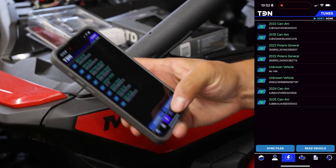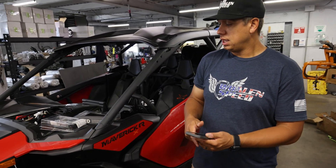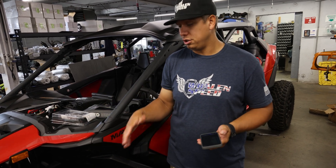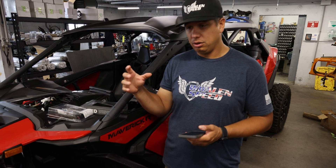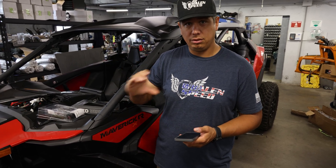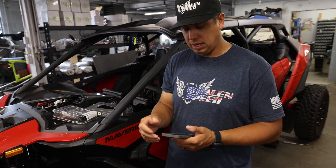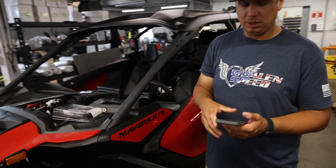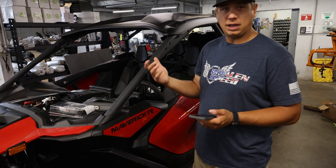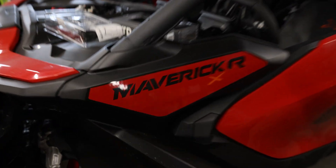At this point you're all set — the machine is flashed and you're ready to go. If you start with stock injector tunes and want to go to E85 later, you'll keep your stock injector tunes in there and we'll send you the big injector tune — your account will still have all those tune files and you can just flash them. The configuration and setup is probably the hardest part; once it's configured, flashing is super easy and quick. Thanks for watching.